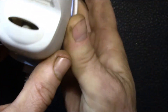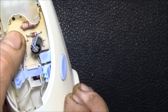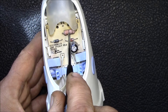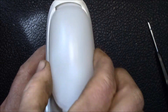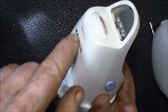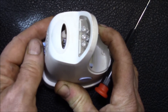Looking inside, there's a surface right there, and on this side that surface is the circuit board, mounted on a plastic structure inside. There are two little holes right there. This resistor right here is really hot — it's a 33 ohm resistor dissipating about three watts. When you have the translucent cover on, this whole area is sealed up. The way it works is air is pulled in through the intake vents, gets heated, and passes out those two little holes. This is the maximum scent setting, and when you go to minimum scent, you can see how far away it is.